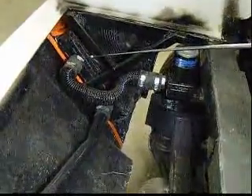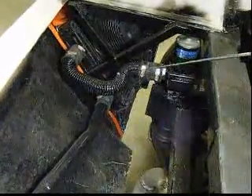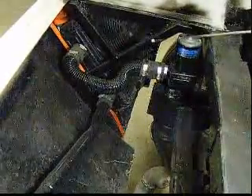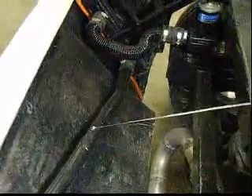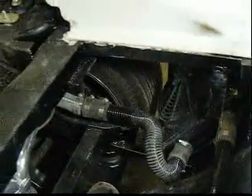Here you can see the cool flex pipe that mounts the top of the radiator to the remote water pump, and there's a little flexibility in that cool flex pipe so that there isn't a possibility of any type of cracking or any tension between the chassis and the radiator. At the bottom of the radiator we have a connecting pipe because these radiators are hooked up in series, where the hot water will come out and then join the radiator at the right hand side of the car. As the water comes into the second radiator it'll go back into the engine block.